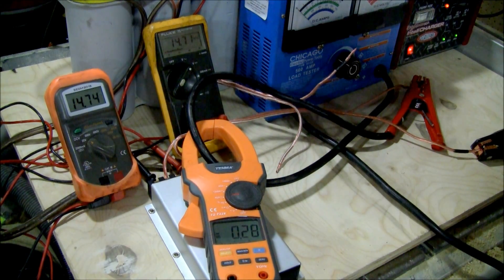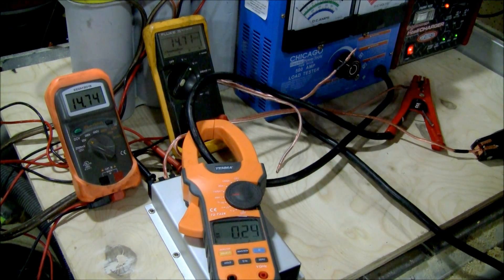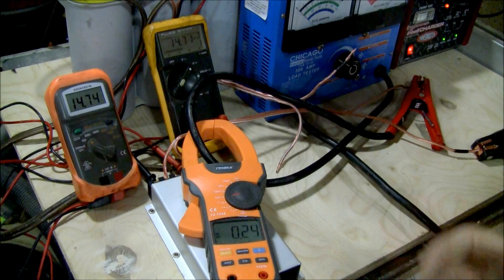Keep that in mind — some places always say you should do a thousand watts with 1 Farad. So this is saying you should have a 5,000 watt system, which Illumipro does not feel that way, as they have 4 gauge inputs on this cap.